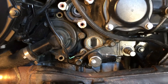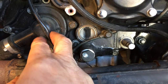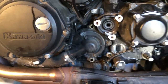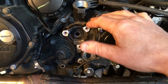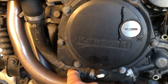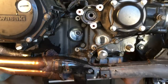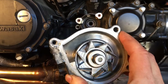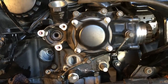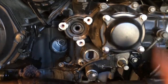With those two items removed, I'm going to unplug the wiring harness at this point — down in there — and move this wire. That's the neutral switch and oil pressure. We're pretty close to having access to the bevel gear case. Still have to take off the water pump. I have drained the coolant, which comes out at a bolt behind here, and I have drained the engine oil too. Okay, the water pump is off — first you take the cover off, then take the hoses off, then pull it out and replace the old ring. I think everything is ready to pull the case mounting bolts and take this entire unit off.